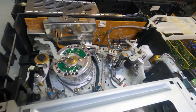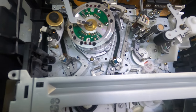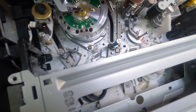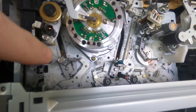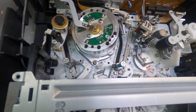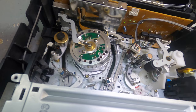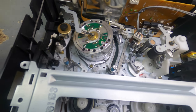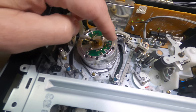It might look a little intimidating, but do not be afraid. This is the basic construction of most VCRs. You can see the blue gear — that's actually the one that was broken. These two items here are called take-up rails. They pull the tape up across the head, and as the head spins it picks up the magnetic frequency, the wavelength, and basically transcodes it and plays it to your TV. This is a Hi-Fi four-head VCR, which is why it's worth more than a common VCR.